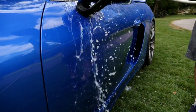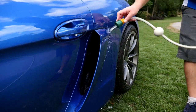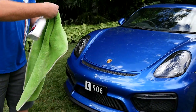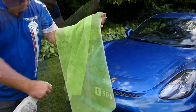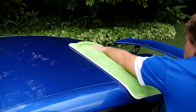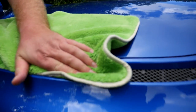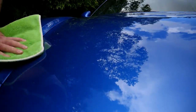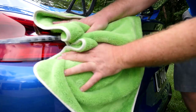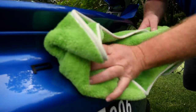When you've completed the car, remove the hose end and rinse the wash suds away with a steady stream of water. This reduces the amount of water left sitting on the panels and will further help speed up your drying time. Another important part of our safe wash system is the Big Green Sucker drying towel. Use it by misting both sides with the Boss Gloss detailing spray, as it works as both a lubricant and a drying aid. With its thick 1000 GSM blend of super soft and absorbent microfiber, it can hold a serious amount of water. Its plush material also means if you come across a dirty section you missed while washing, it won't push that grime hard into the surface, helping prevent micro scratches.